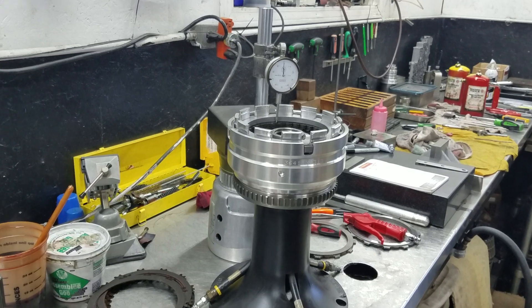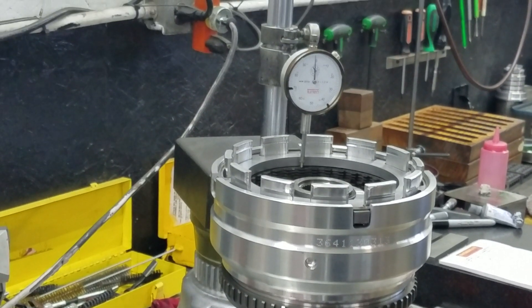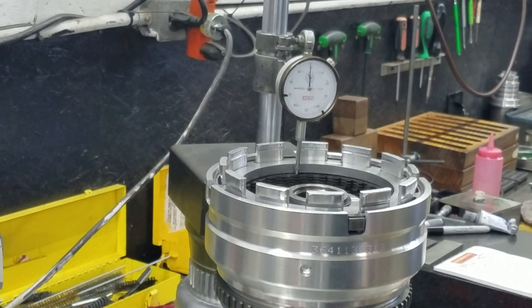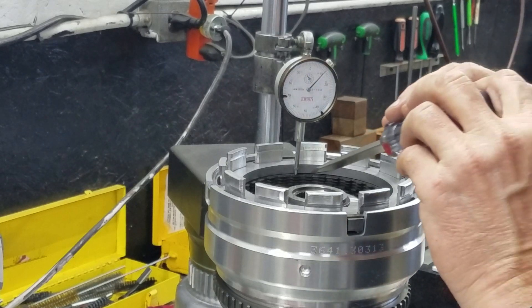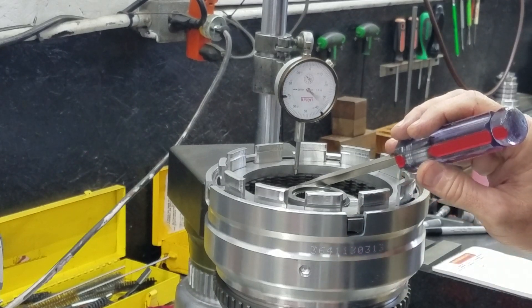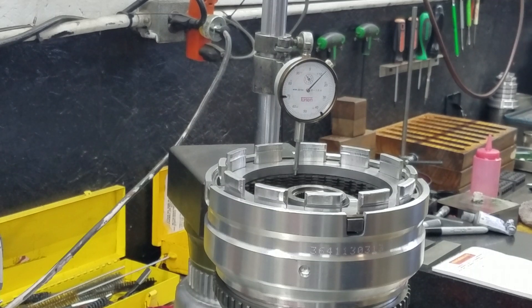So you can see the gauge is zeroed. I'm sitting on top of the very first OD clutch. Now we're going to put air in the underdrive circuit — this is full shop air. See, now it shows 11. So now we'll look at the clearance that remains: 40. So my actual OD clutch pack clearance with the underdrive applied is only 29.